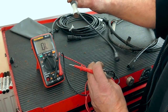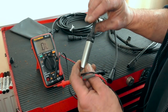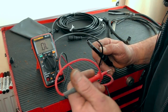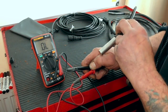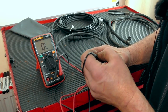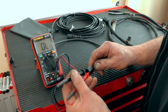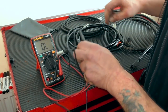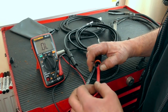I can get in here, and what I was doing was checking continuity for this sensor — and I got open circuit. That's actually not good; there's no resistance in there whatsoever. Somewhere I thought maybe I hadn't got proper contact, so I used my extension lead — a test lead for test purposes — and checked again: no resistance. That should be reading about 1.7, and it's not at all.